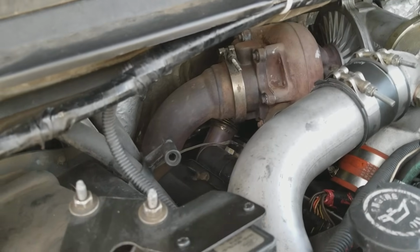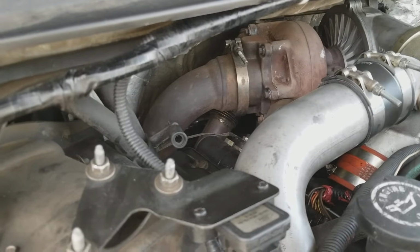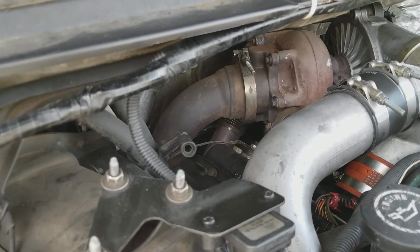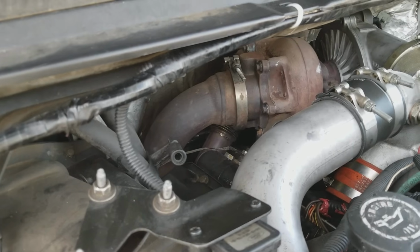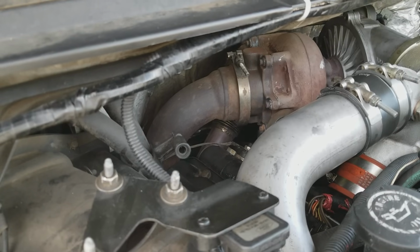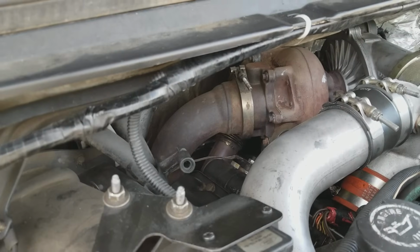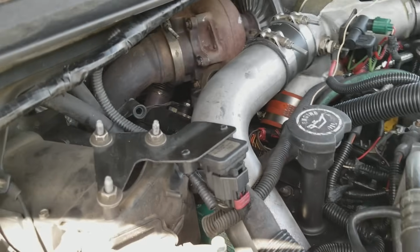The other thing that tends to leak oil is in the back of the engine behind the cylinder heads, because of the heat from the exhaust right there. There are plugs in the back of the head for the high pressure oil, and they're not normally supposed to be removed, but they're there as, I think, a boring plug for something, I can't remember. I had the heads off and I don't recall, but there's a plug back in there, and those tend to leak oil from the O-rings. You can actually do an in-car repair and fix that by just removing the down tube, because it's right near the down tube where it goes down the head, and those O-rings get hot.